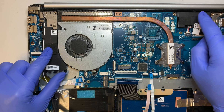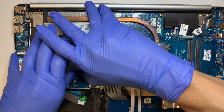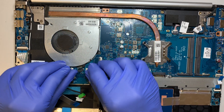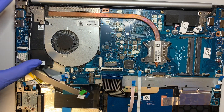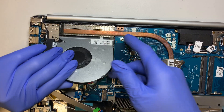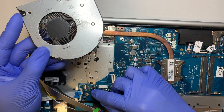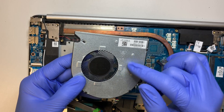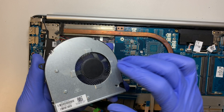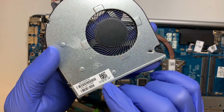Here's your speaker - there's one here and one at the top right. This is the CPU fan connector - to remove it, same thing, push it away from you. One screw holds the fan and this is the cable that plugs into the motherboard. If you have a problem with the fan, like it's not spinning correctly or you hear a grinding noise, you need to replace it - it's very simple. To find a fan replacement, look it up using this model number.